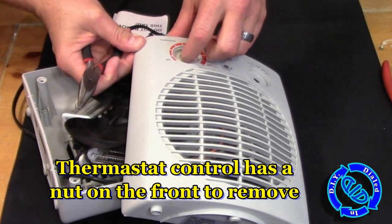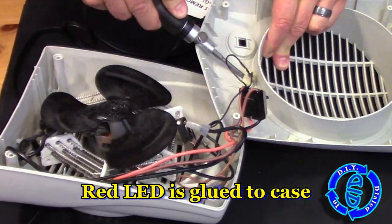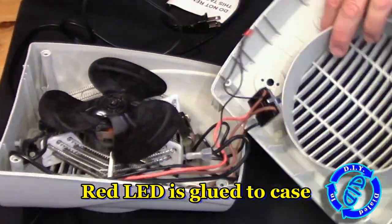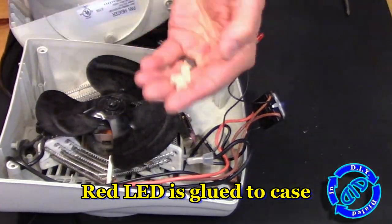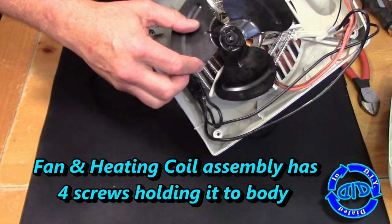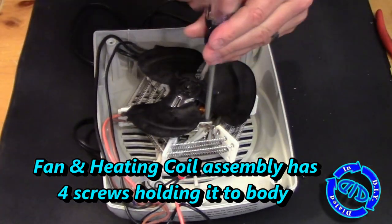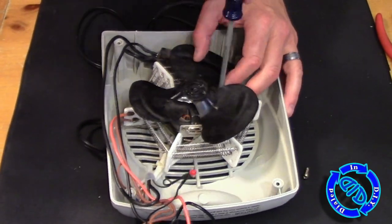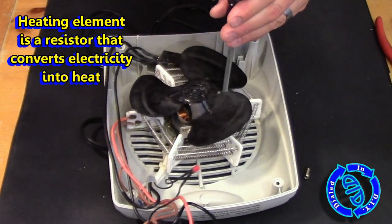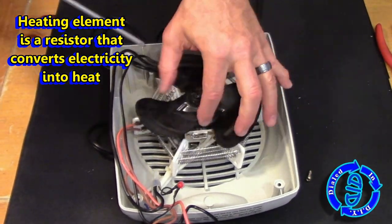In the top corner, you can see the picture of the cutoff switch that I'm taking off the bottom of this. This is basically a very simple switch that will turn off all the power if the fan tips over. This particular dial on the front is a manual thermostat that allows you to adjust how much heat the coils will produce — turn it up, you get more heat; turn it down, you get less heat. In this particular unit, you turn it up and the heat just cuts off. So far, I've been looking for obvious signs of things overheating, failing, or a loose wire and haven't found them, so I'm going ahead and taking everything out to look at it from all angles and see if there's anything obvious that went wrong.